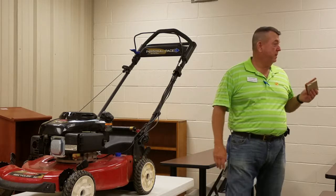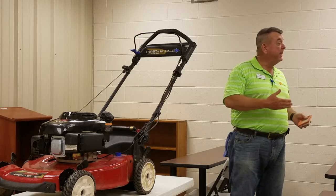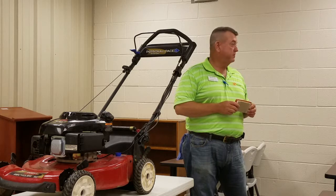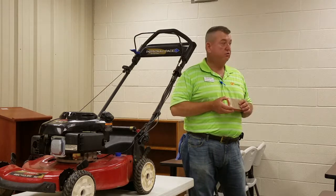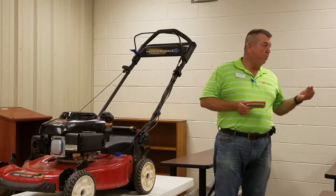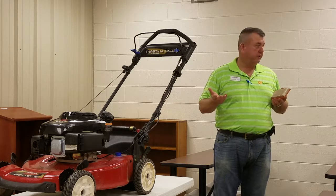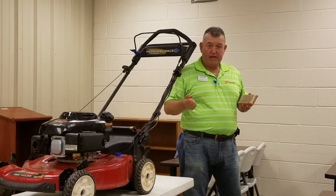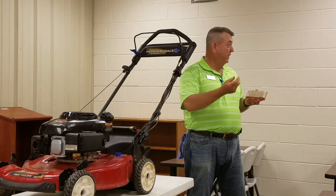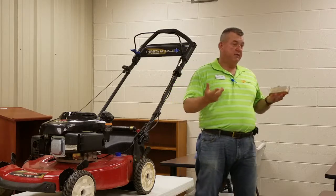Your book will tell you to check and clean it every 25 hours, or more often in dusty conditions. In the spring when things are lush and cool with lots of moisture, you don't kick up that much dirt. This time of year with drier conditions you create more dust, and in the fall when you're chopping leaves you create more dust too. If you have a foam filter, you can wash it with detergent water, squeeze it out really good, let it dry, and then add a few drops of clean motor oil and work it in — the oil helps catch particles. Those can be reused over and over until they wear out.